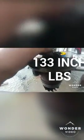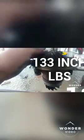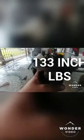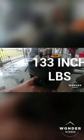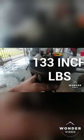Then slide your compressor wheel back on - if you have a new one, this is a good time to put it on. Tighten your nut down - remember it's reverse thread - hold the back nut, take your impact, run it down and do a quick hit. I'm not sure of the torque spec but I'll look it up and maybe put it in the description. That's going to do it for the turbo rebuild on a stock HX35. Next video we're going to be swapping out the exhaust housing and putting this turbo on the Fummins to see if I did a good or bad job on the rebuild. Thanks for watching.